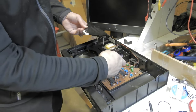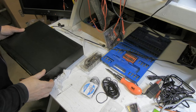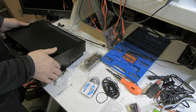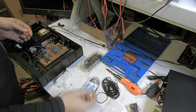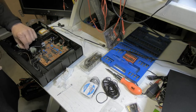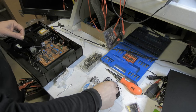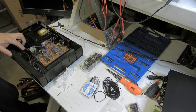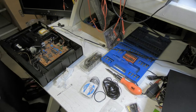Back on the CD player project — I got it all back together and it didn't work. It just didn't get enough traction with that little skinny belt. The belt was kind of greasy out of the package, kind of shiny and oily feeling, so I cleaned everything with alcohol and put it back together, but it still doesn't get enough traction. I could try a tighter belt but it might just break.